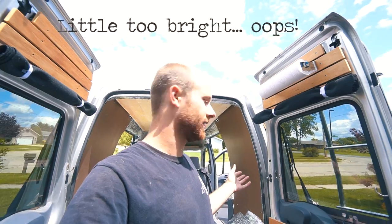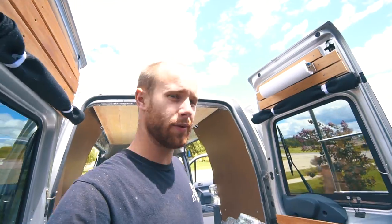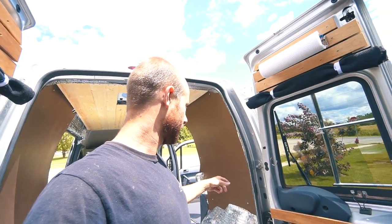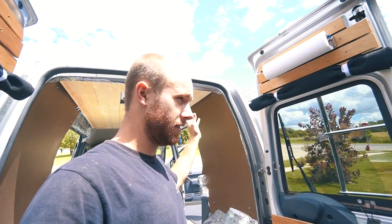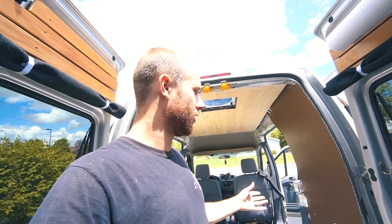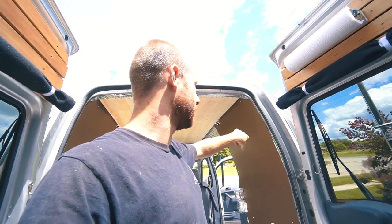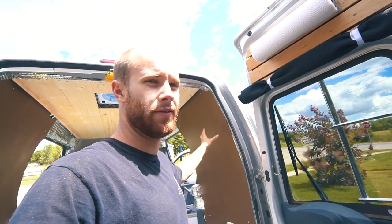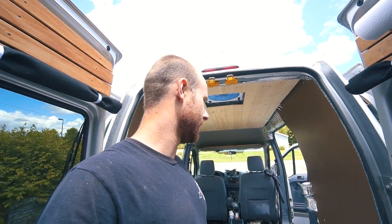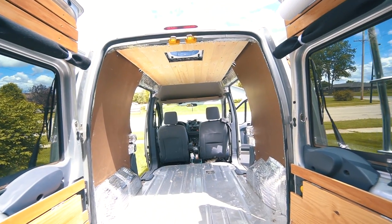I got the masonite panels up - the cardboard stenciling worked. It's just a tedious process but it worked. What I did was screw the panels in where I wanted the attachment points and then hung them to get an idea of what I'm working with. I'm going to go buy some carpet and wrap them. I have a little insulation left I'm going to put behind the panels in the cavity there, and then wrap them in this gray automotive carpet that should make it start to look more home-like.